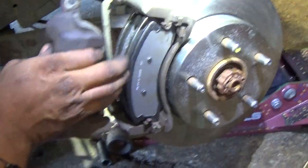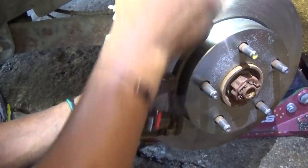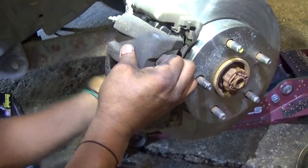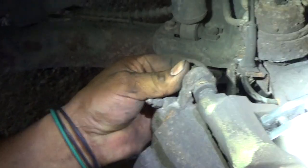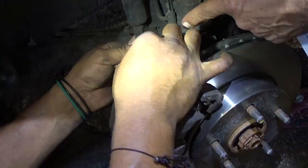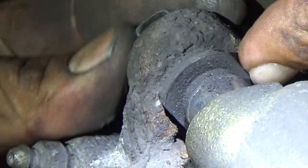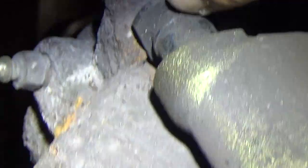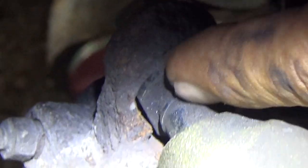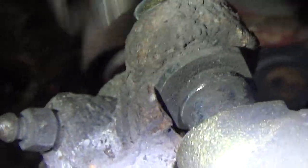He's going to install the new pad and now the brake caliper. You've also got two bolts on that — your upper bolt. If you have this guide tip right here, you have a flat spot here and you also have an area where you can make sure you line up that flat spot with that caliper. Very important that you do that. It's basically a stopper point so that you don't have to use a wrench behind it. What you're doing is tightening the front bolt and it comes to that stopping point where it's not going to move — it's going to allow you to tighten.